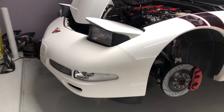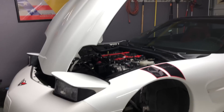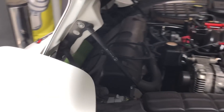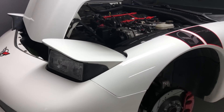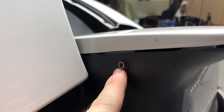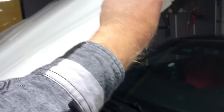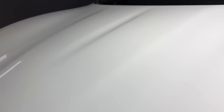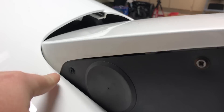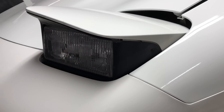Next you're going to want to disconnect the battery so your lights aren't running the whole time you're working on the car. You'll also want to pop the hood for better access around the sides of the headlight assembly. Then get a screwdriver and take out the screws in the side plastic — you'll need to set the hood down temporarily to access one side. There are two screws on one side and one on the other.